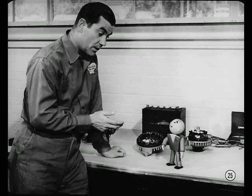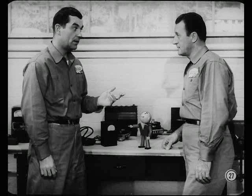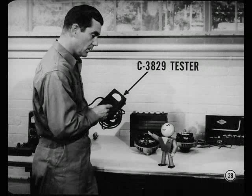Let's get on with the job of testing the diode rectifiers. If the alternator output was slightly under specs — that is, 5 to 7 amps low — it could mean one of the rectifiers has an open circuit. And if the output was excessively low, it would usually mean there's a shorted rectifier. We know what we're looking for, so we can use this tester to find it. With this new tester, you don't have to open the Y connection to test the rectifiers. It sure saves time.